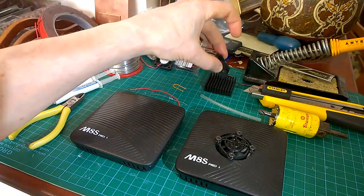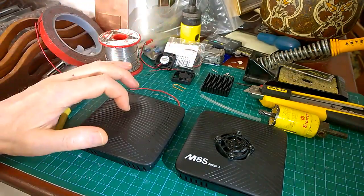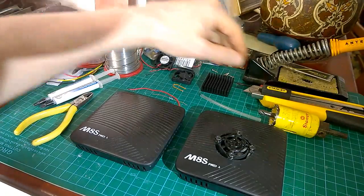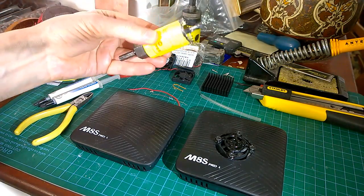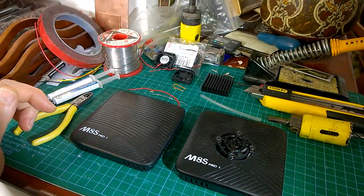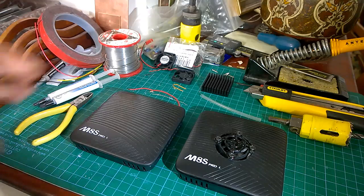I'm also not going to replace that heatsink using that heatsink. I'm going to use the original one, and then this will fit completely inside. In the top, fitting completely inside, you don't use a 38mm hole. You use, well, probably a 28mm hole would be best, but I've only got a 30mm, so I'm going to try that and see if it works. Hopefully it should. I'll cut that off camera using a pillar drill, but you can use any old hand drill with that kind of hole cutter in it, hole saw.